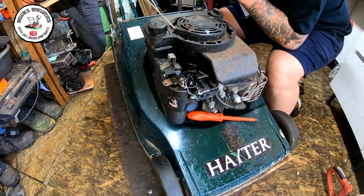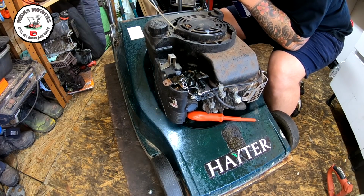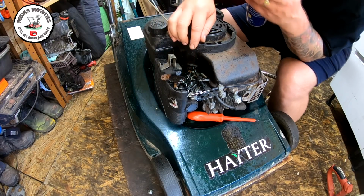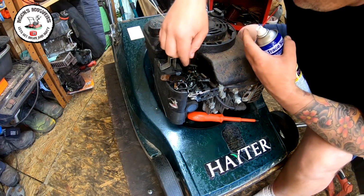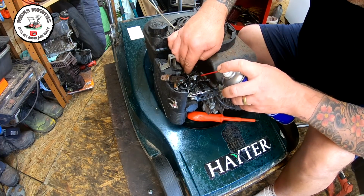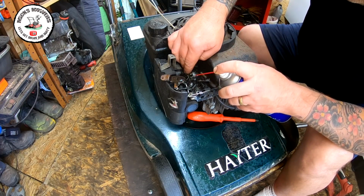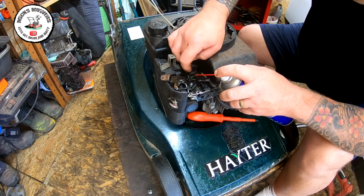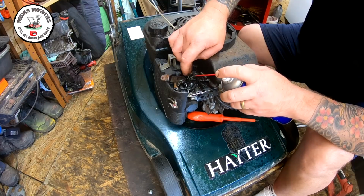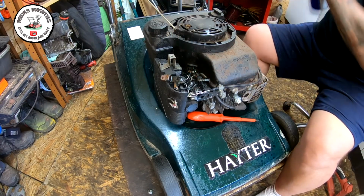And it's just because that throttle linkage will not turn, especially on top of the carburetor on this one here. It won't rotate up because of the way it's got so much dirt behind there. So the throttle one is the main one, which is the one at the back here, and it is 100% looser than what it was before. So I'm hoping that will do the job.